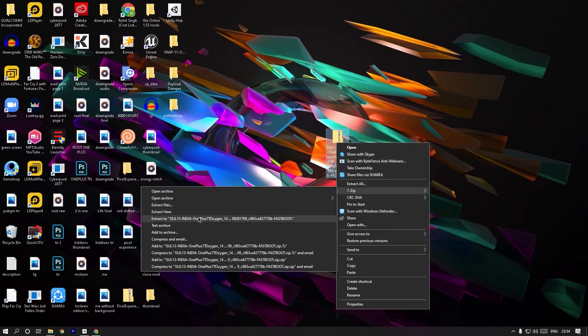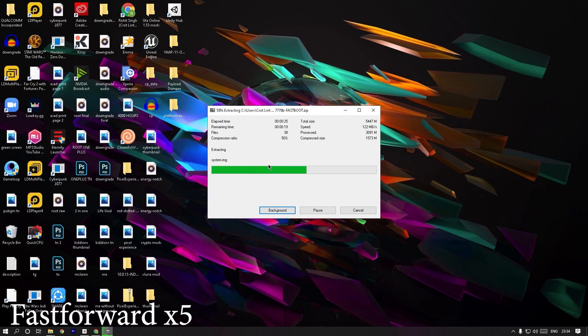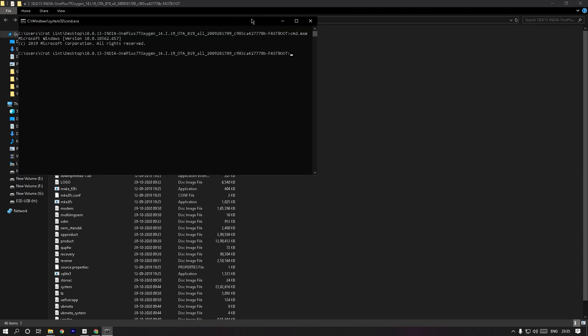I live in India so I downloaded the India version. Then you need to extract this zip file using 7-Zip or any other unzip software. Once you unzip the file, open the extracted folder, click on the search icon at the top and type CMD, then type 'fastboot devices'. If you can see a string of numbers with 'fastboot' written beside it, your PC has detected your device in fastboot mode. If not, download all the drivers from the link in the description and install them on your PC.